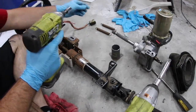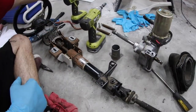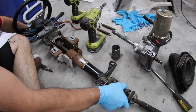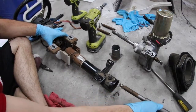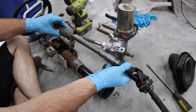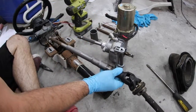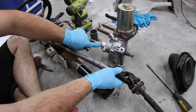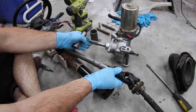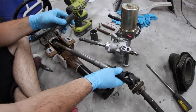Surprisingly easy. We should just be able to grab the back of this shaft here and pull this whole thing out — and there we go, just pull it right out. This will go over this and will be welded to the spline portion here that fits over this spline count. I wish these things were splined all the way down — it's just not the way they're manufactured — because then we could cut it even shorter since we only have two inches of engagement area here.